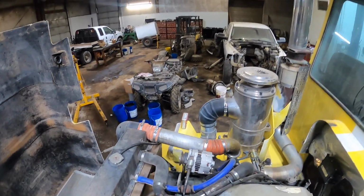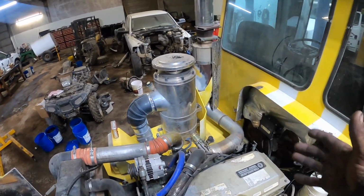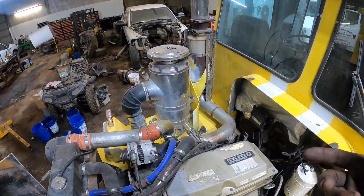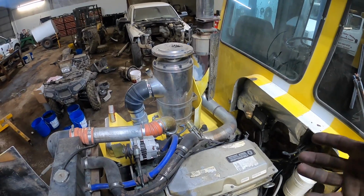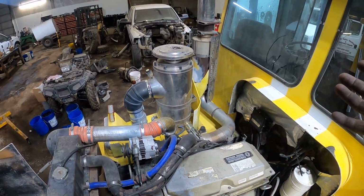We're going to find out in a minute because we're going to pull the plug. This is the engine. If you don't remember, I out of framed it. I sent the crank off and it was polished because I was a little skeptical because it spun a number 2 journal, I think it was. The crank balancer was totally disintegrated and shot in it. The bearings had fell clear out of it.